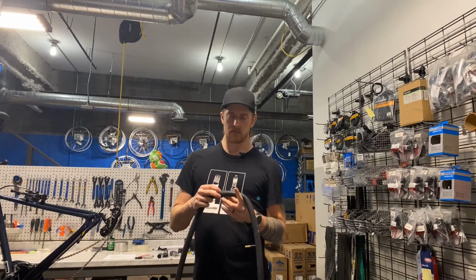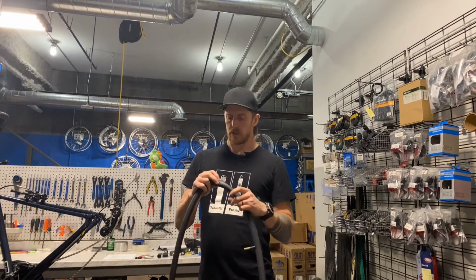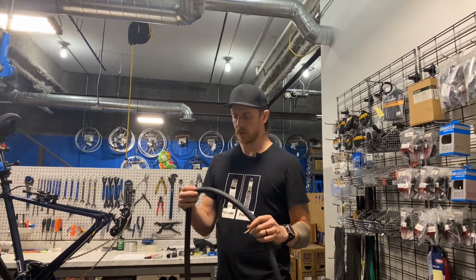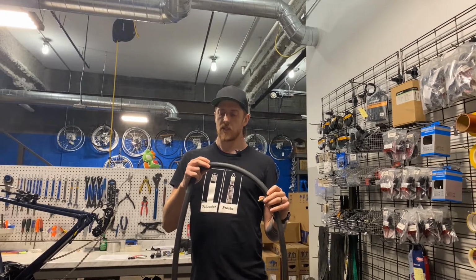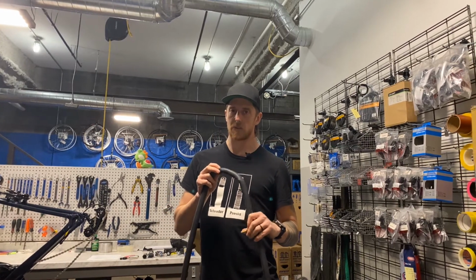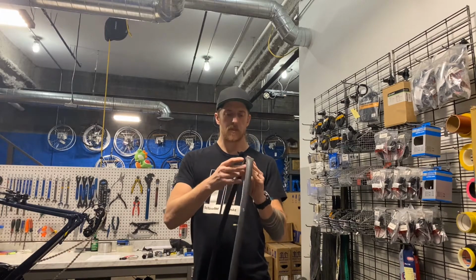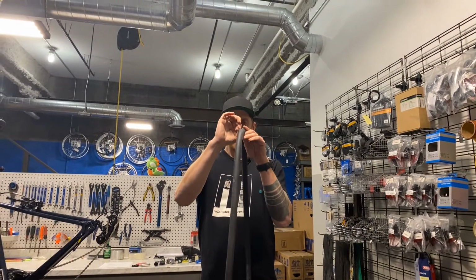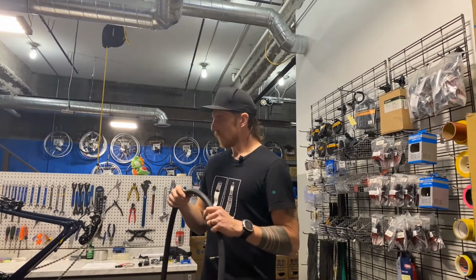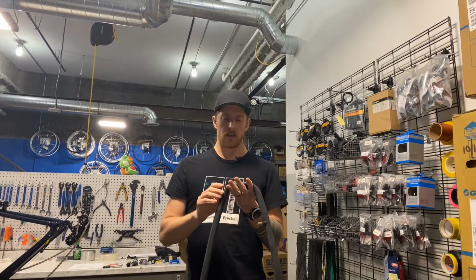A broomstick, you know, whatever. Random person. You can pinch flat on all sorts of things. Curbs and potholes are the most common. That usually is a sign that there probably isn't something in your tire, but you should also check the sidewall of your tire to make sure it didn't blow it out, because that's also possible. But pinch flat happens, the tube literally gets pinched between the rim and the tire, and it gets what looks like a snake bite.